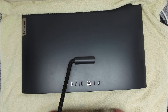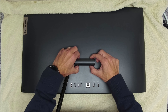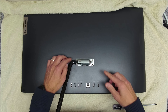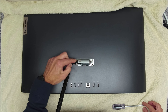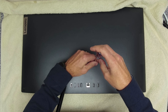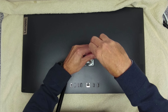So let's start, shall we? The first thing we want to do is we've got this plastic clip here, so we want to squeeze together the edges and just lift that off. Next we're going to take the stand off — there are four screws, one in each corner. This metal bar is slightly recessed, so you can still get the screwdriver in. We'll remove these and put them in a little plastic cover so they're all together.